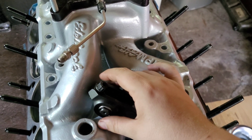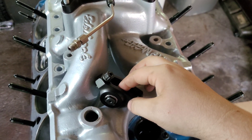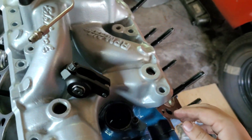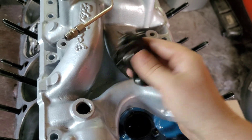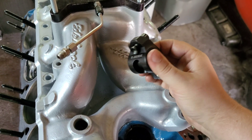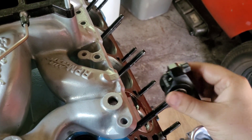Not everything is glorious about them though — they came with the wrong size bolts. They came with metric bolts, and this is not metric. This is a 5/16" by 18 thread pattern. So what I had to do was go find Grade 8 hardware that works. They are a quarter inch longer than the ones supplied, but they still work in those heads. A quarter inch more thread engagement with the cylinder head — I'm good with that. I still have to check push rod length and order up a set of nicer push rods.